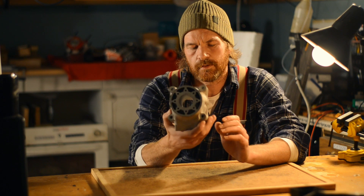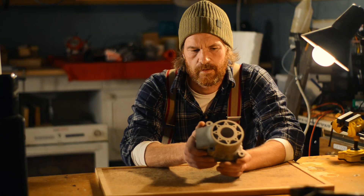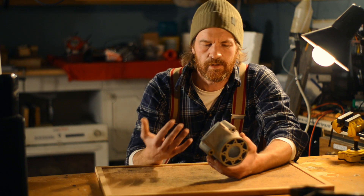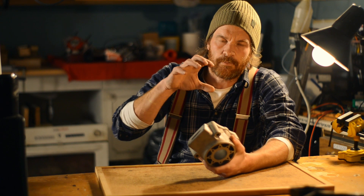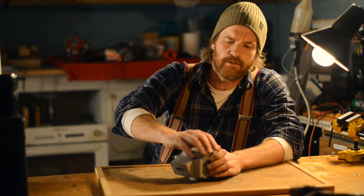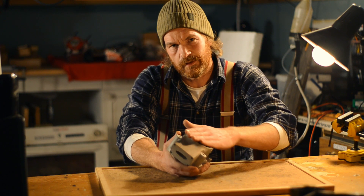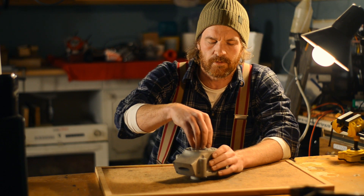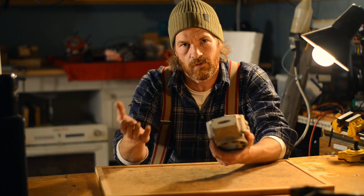This brings me to why 3D print a cylinder though. Reasonable for what it is - it is expensive, or is it? The first and most important reason is you can 3D print stuff that's completely uncastable, like really intricate cooling circuitry with tiny channels and internal cooling fins. Rectifier-type stuff in the transfer ducts might be possible. You could include the head and print the whole thing, and have really intricate cooling circuitry going into the head - preventing cooling of the combustion chamber but cooling the squish band and the plug. There's no end to the possibilities.